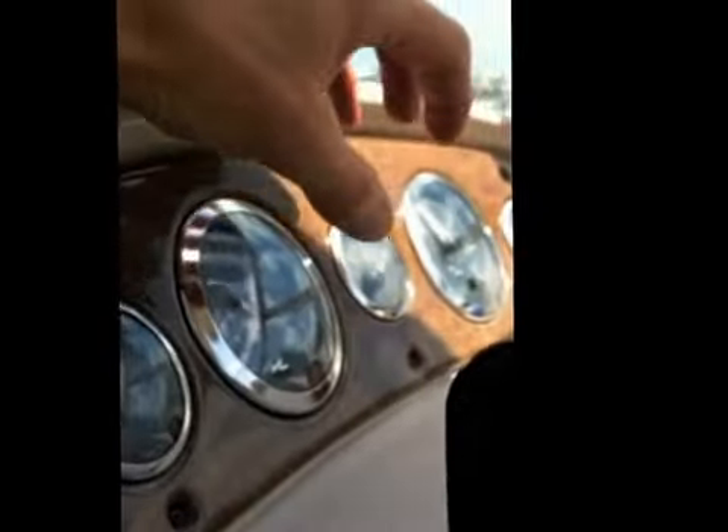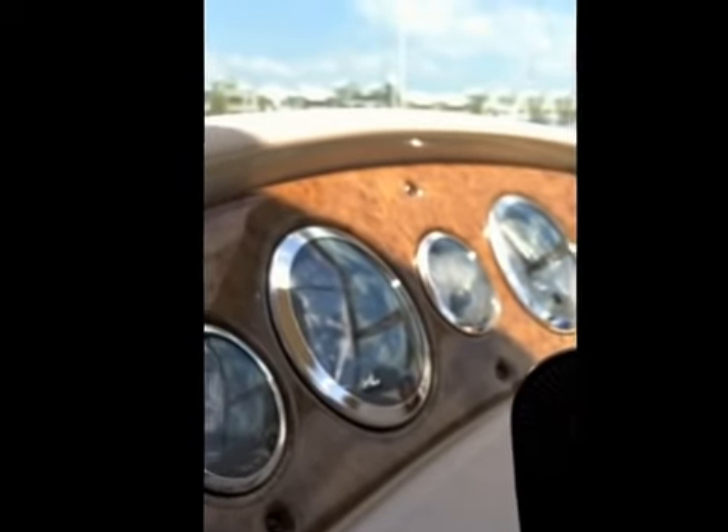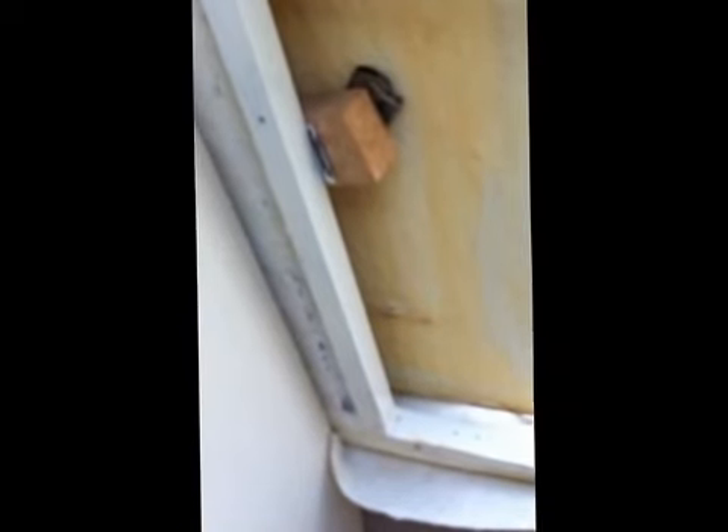To get to the forward screws, I had to take all the screws off the instrument cluster, which is pretty easy, and lift that out gently — a lot of wires that can keep it bound in, so just be gentle. To the forward of that cluster, the door track runs up inside. I had to purchase a special tool, which I'll show you a little later, which gives you a 90-degree drilling or screwing capacity. So I could actually just manage to get the drill up and locate the screw heads with that tool piece with both hands. It's kind of tricky, but I managed.